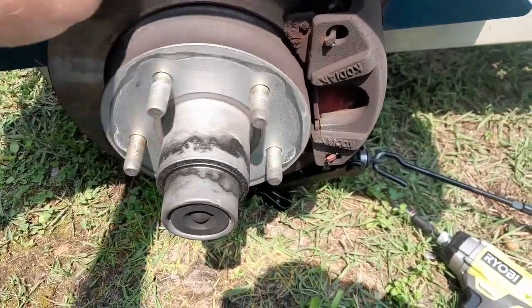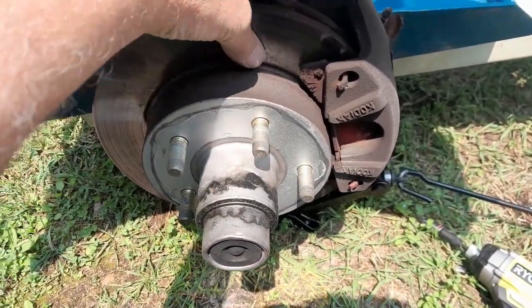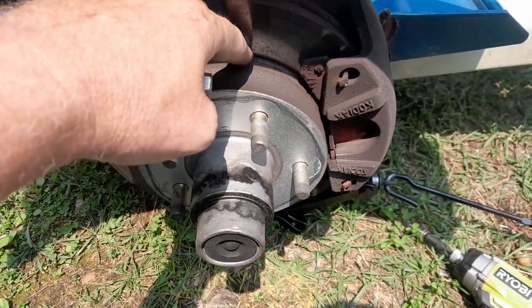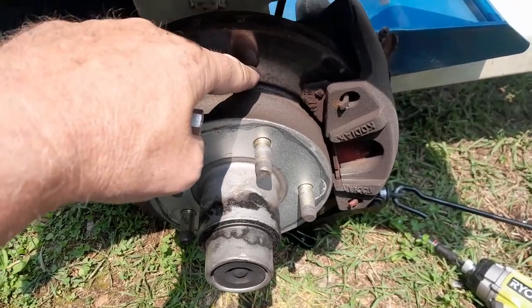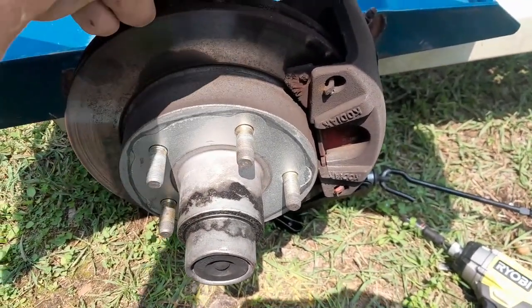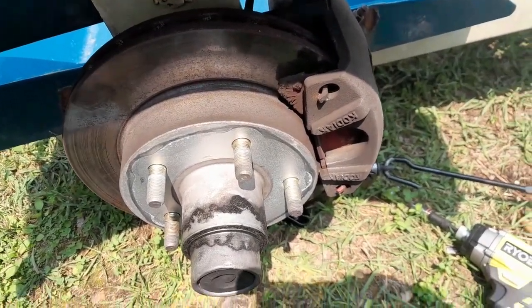We always want to make sure this is spinning a little bit — it's actually rubbing on my brakes. You also want to check these rotors. You basically run your fingernail across it. If you don't feel a lot of bumping, you're probably pretty good. This is pretty good — nice and smooth — and I can feel it from the other side too. No issues there.